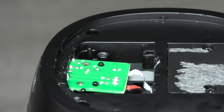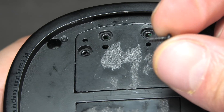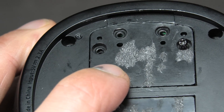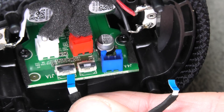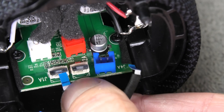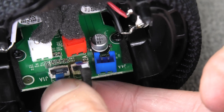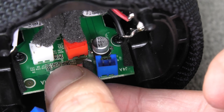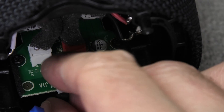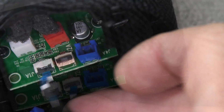Make sure the USB charging port really sticks out, then put the cover back on with the screws — you should have four small screws and four slightly longer screws; this section uses the shorter screws. For the ribbon cables towards the core of the speaker, there are two types: the wider one goes to the left, the narrower one goes to the right — you can't put the wider one into the narrow port.